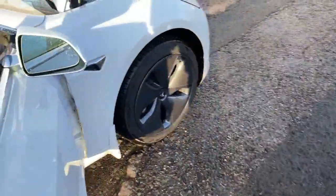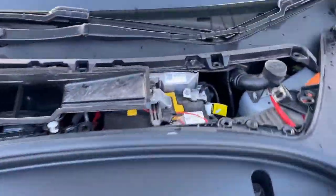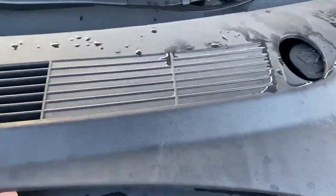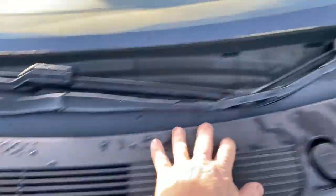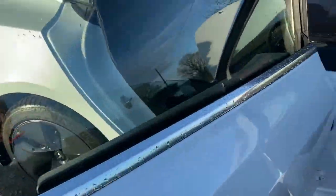Keeping the doors open, go back to the front of the car. At this point you can now reconnect the 12 volt battery and replace the panel. After you've done that you can then close the doors and the car will reboot after about two minutes or so.